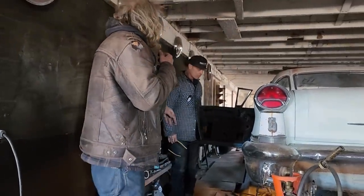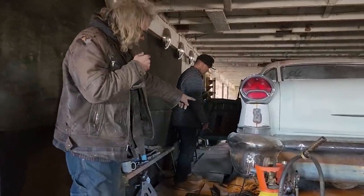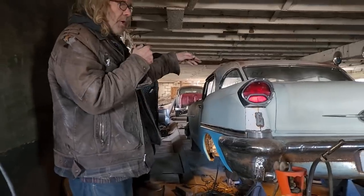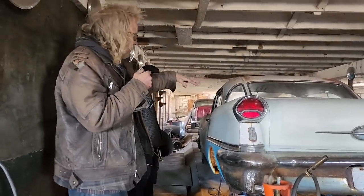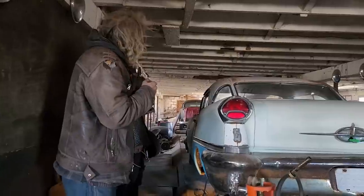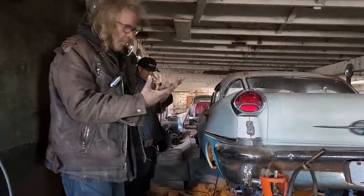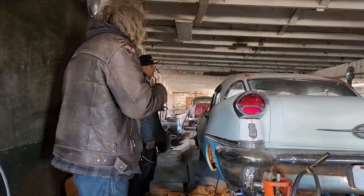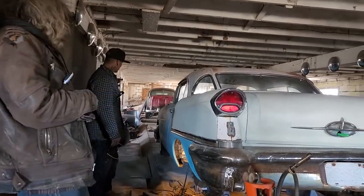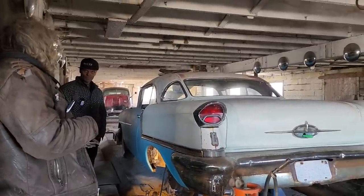Can I shut your door and get a visual? I'm leaving the bottom of the sill part to last because as I work on it, the crap is falling down from up above, and once it falls down I'll take the blowgun and blow it out, then I'll put that patch on. I don't want to trap a whole bunch of crap inside the sill — I've already got most of it out.